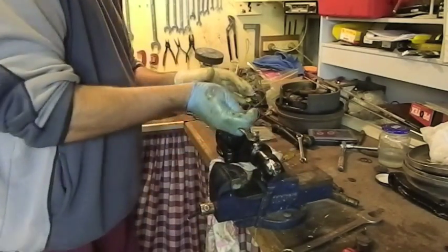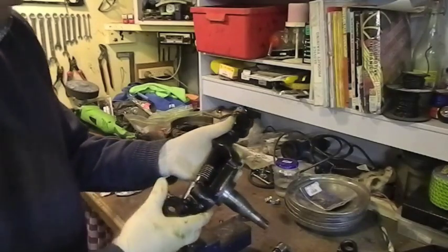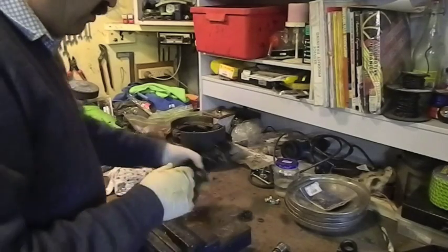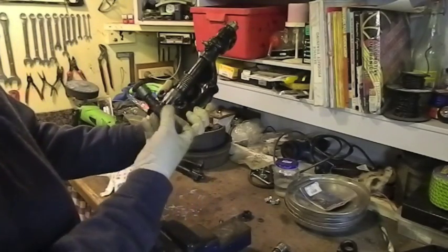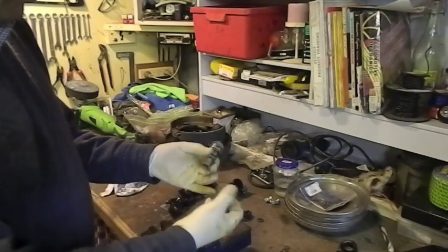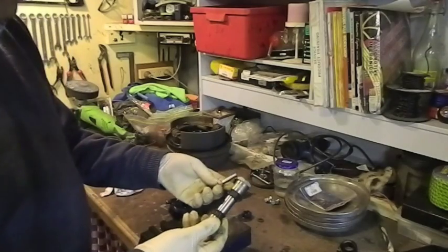Now the grease - I've got some molly grease. This kingpin setup, in my opinion, is looking pretty good. There's no movement in there. One thing that does worry me a little bit is this fulcrum at the bottom. It sort of fits in here with a cotter pin. They do wear on the threads and that's quite loose there - the other side was a lot better. So I've bought two new ones - two new ends and a new pin itself. That's lovely and tight. There's no movement there, obviously, because it's new. And in fitting that, I can sort of secure it home with a new cotter pin.